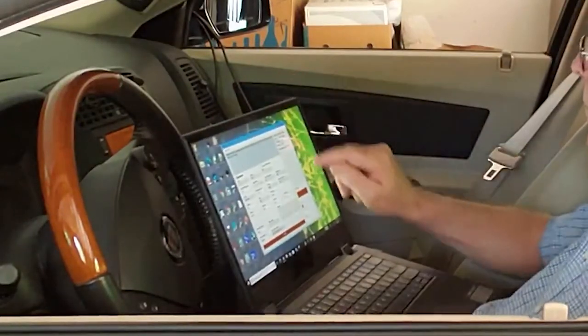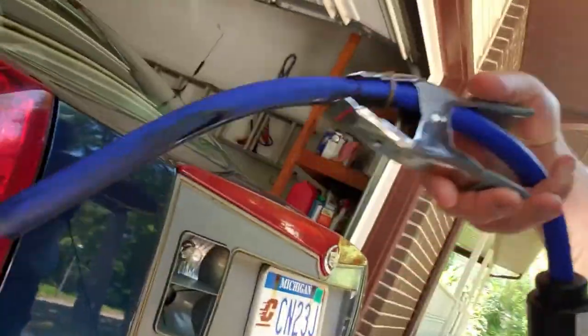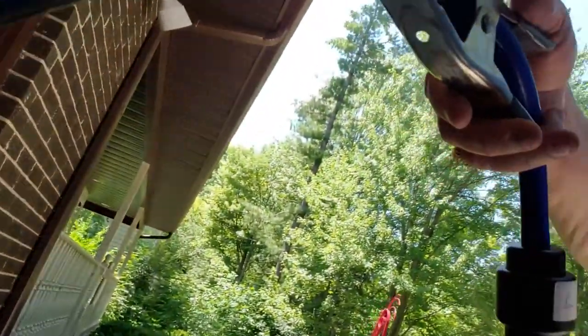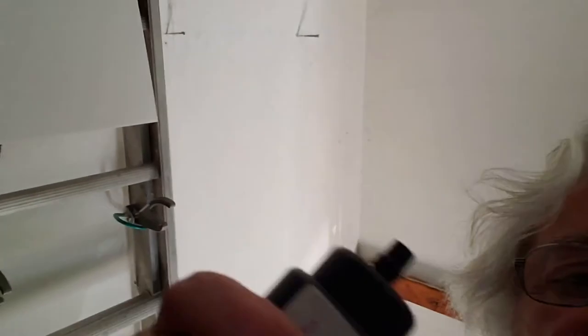I'm going to shut the engine down and talk a little about taking down the equipment. I'm first pulling the exhaust sensor out of the tailpipe. I want to take the sensor off the hose since there can be moisture trapped from the exhaust gases in the hose, and I want to keep the piezoelectric sensor as dry as possible. So now I'm just unthreading that first look sensor.